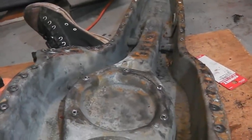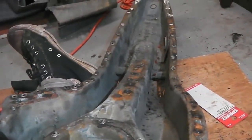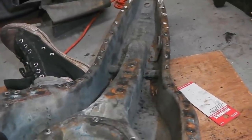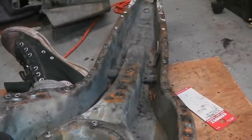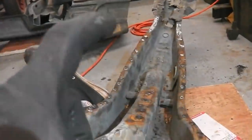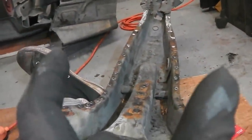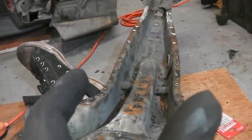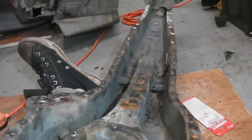When you put your axle on, it's going to pull on the axle a bit. If that did happen, it wouldn't necessarily be the end of the world, because you could alter your swinging arms. You can certainly cut and shut swinging arms to suit, and the axle does have serrated plates on it, which makes the axle actually move. You can twist your axle either way you want on these serrated plates. If the ends of my fingers are each wheel, the axle goes like this on the serrated plates. You can twist on early ones anyway. Later ones have it fixed.